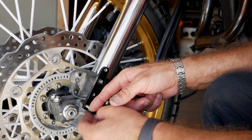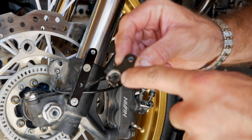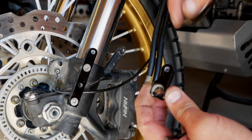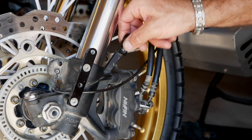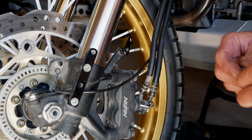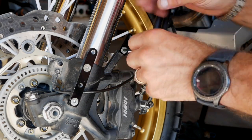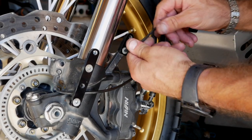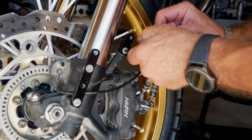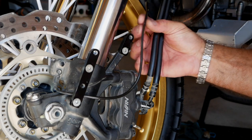The screws go in the OEM location in the back. The back piece is also tapered, and that little groove goes towards the back. Once you place it like that, it slides on top of the original mounting point and you use a screw to secure it. Leave a little bit of movement — don't tighten it all the way until you get the fender back on. Whatever you do, you don't want to pinch this cable.